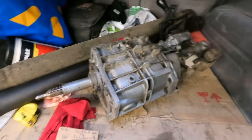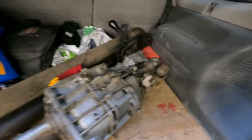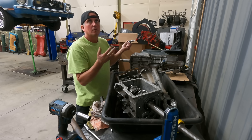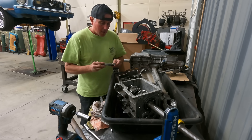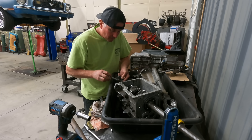I found a T5 transmission. I don't know what vehicle this one came out of — it could be a '90s Thunderbird or a '90s Mustang. The important thing is that it has the same spline input shaft, the distances on all the numbers are pretty close, and it was only 300 bucks. I'm going to drag this thing out and set it up with the other four-speed, and figure out if it's actually going to bolt in the car. If it bolts in, I'm driving this thing to work tomorrow. Most of what I found online says you'll still need to build a custom pilot bearing, which centers the input of the transmission into the back of the crank.